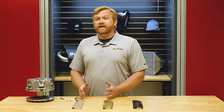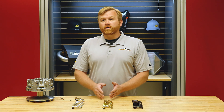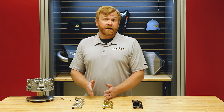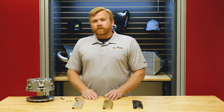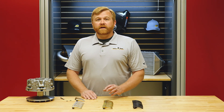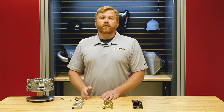You might find on the sand that if you've clutched really light to try to get maybe 8,400 RPMs, when you put it on a big load hitting a long hill, you're back down to 8,000 RPMs. That's where the peak torque is, and peak torque falls off really steeply after 8,000 RPMs. Clutching to try to make 8,400 or 8,200 RPMs would sound great and feel great — it's kind of like kicking the muffler off your Honda — but it's not necessarily running better. Proper clutching is really key.